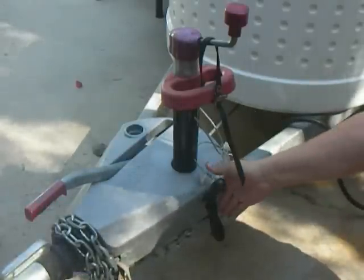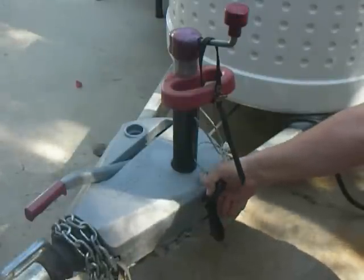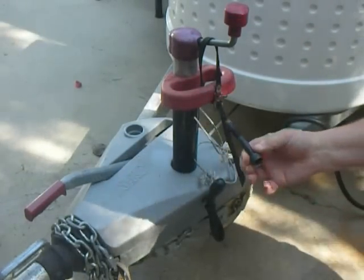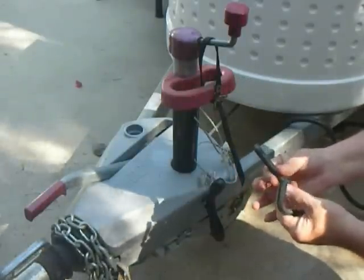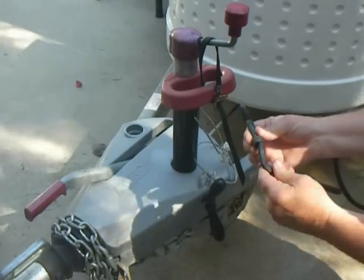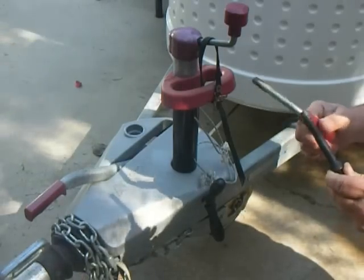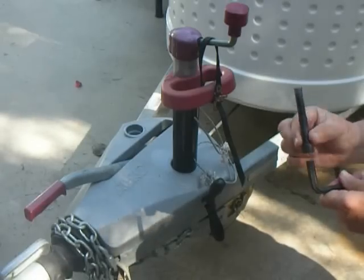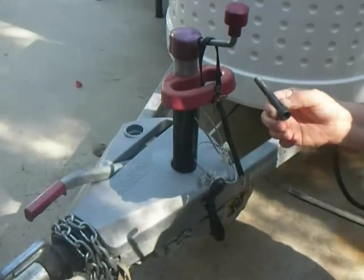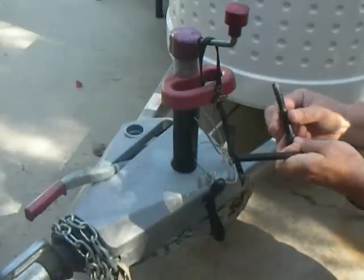You may want to have a spare for this. These handles were ones made by Jim out of Arizona, and Jim has passed away, so those are not available anymore. You can either fabricate something yourself with a heavy-duty handle with grade 8 threads, or using an Allen head — and I'll give you the thread pitch on this. This is a 12mm bolt with a 1.75 thread pitch and is 80mm long. That's what you'll need if you want to have a spare. If this thing breaks off in there, wherever that jack is is where you're stuck. You can probably grab it with some vise grips and loosen it up, but you might want to carry a spare. You can pick up this bolt at a better hardware store — get the Allen wrench to go with it. This particular one takes a 10mm Allen wrench for a 12mm bolt. So: 12mm, 1.75 thread pitch, approximately a minimum of 80mm long, and about half of it being thread, and you should be good to go.